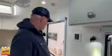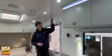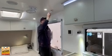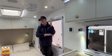Now think of this TV aerial as being flat on the roof, so it's laying flat. You want to stand it upright so it's in position. Now on this crank handle there's an up and down directional. So you just follow what it says. This is up. If you wind it the same direction that says up, you keep on winding it until it comes to a stop. There we go. Now the aerial is standing upright. Now you can also rotate the aerial directional.